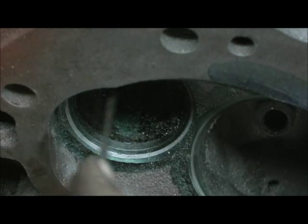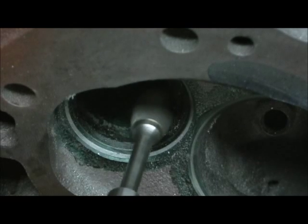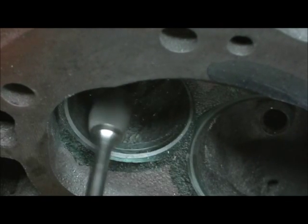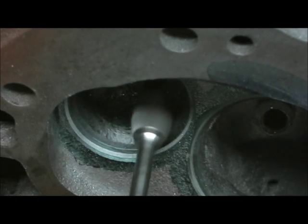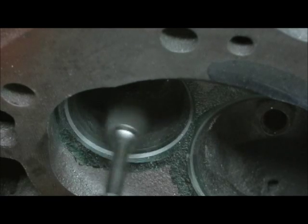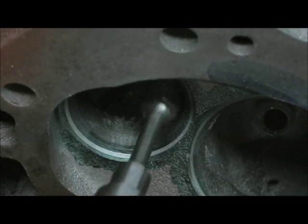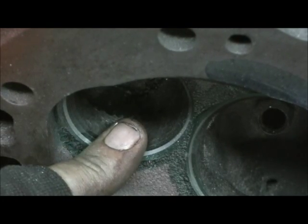I'm just going to go in here and pull that right to the edge, which y'all can see. I'll go in here. Once again, I start at the sharpest point of the tallest and make a slow cut. Then I jump up here. Now, you might think I'm going to go in here and cut all that bowl out — that's not true. I'm getting it down, but I'm going to leave a fillet or a radius right here. There's a reason I'm doing that.